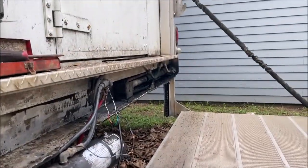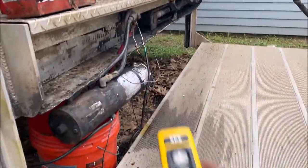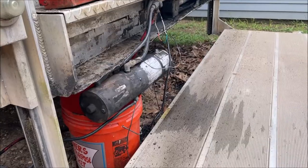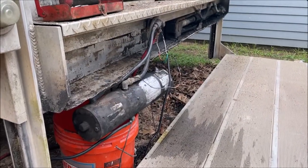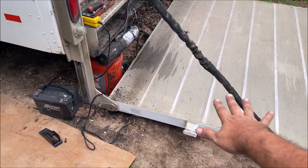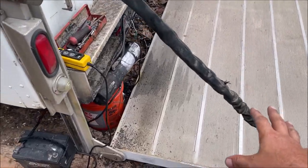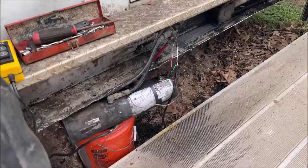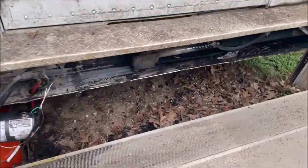It has some little rocks in there for a vent. With the cylinder compressed 100%, this one's supposed to be 75% full if we had a dipstick to check that. If you overfill it, it's going to squirt it out like that. If you're working on something old for the first time, notice how it's not on the ground 100%. I'm going to leave it there for a few hours and see if it leaks down, telling us we have a bad or very tiny leak.